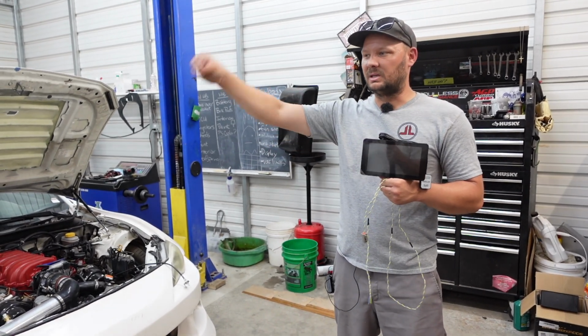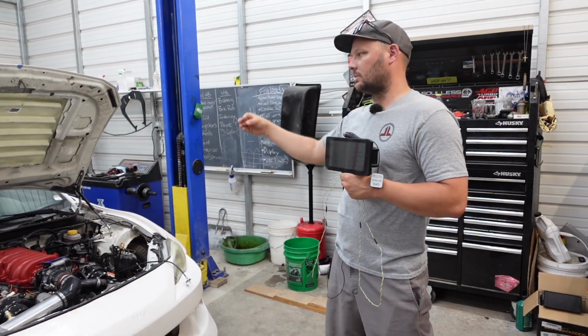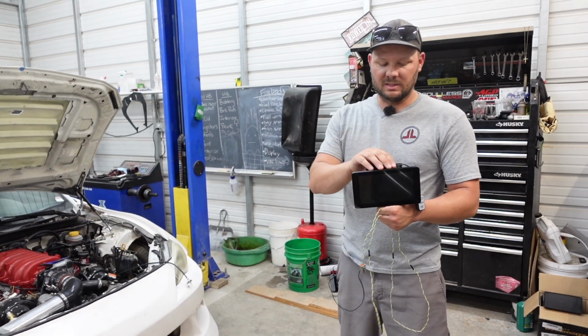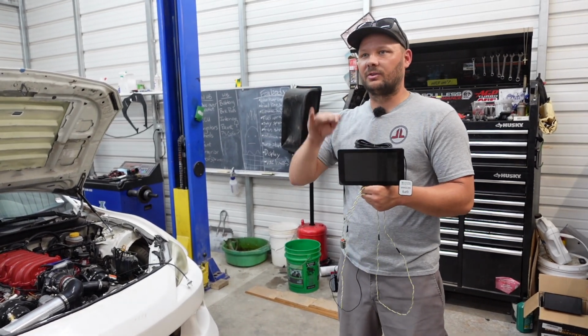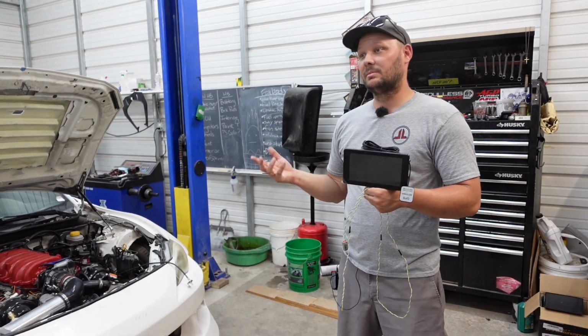So you can set them to different CAN bus protocols. This one has one going to the BRZ, and then one that we're using for the Haltech and the dash and stuff. Right. And the cool part about this dash is you can set it up for a lot of different protocols, so you can piggyback it off of stuff, which is really nice.